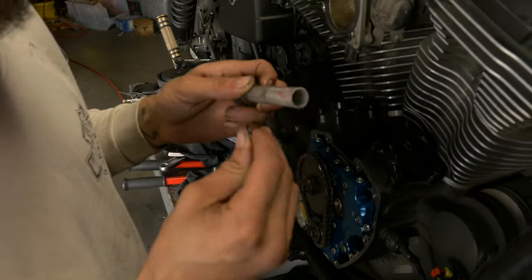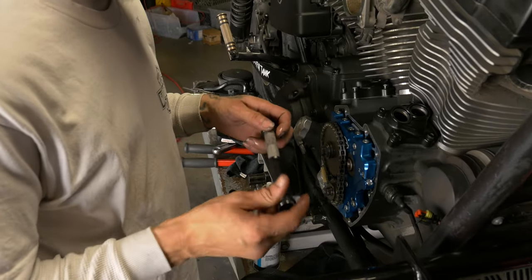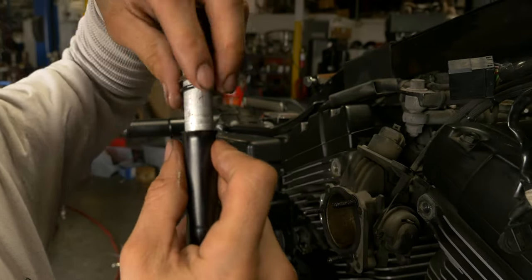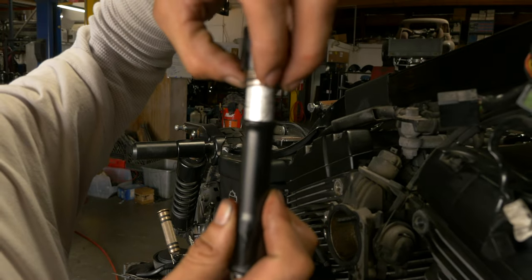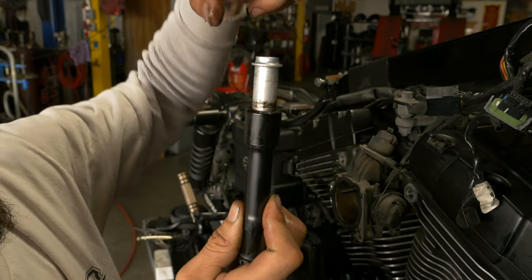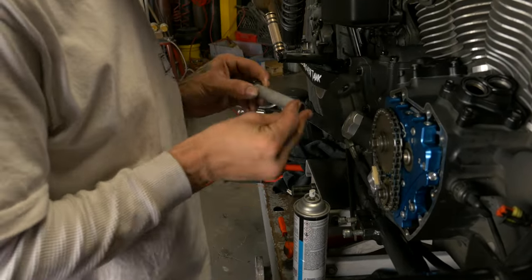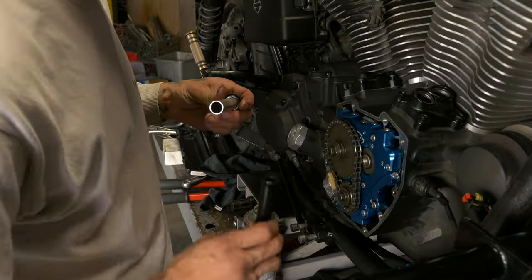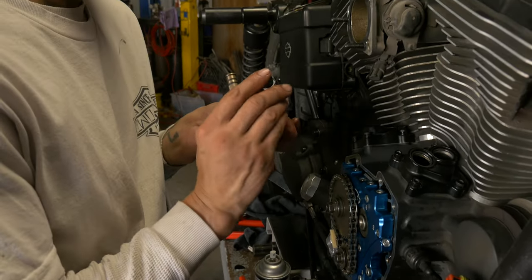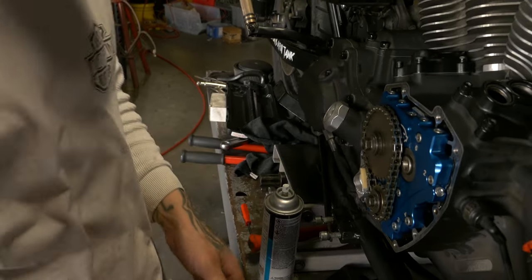The ends of these tubes can be sharp, so try not to cut your O-rings on there. So you got that O-ring right there, seats inside of this little flare. You have the washer that physically pushes it into the seat, and the spring is what's actually pushing it down once you lock it in with the upper. Now all his O-rings will have zero miles, zero wear of any kind. Everything's going to start off fresh together.